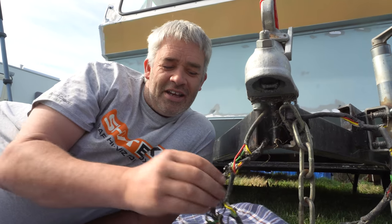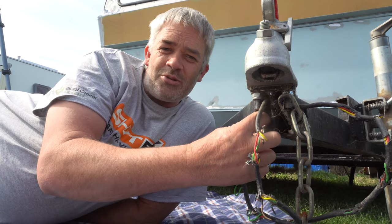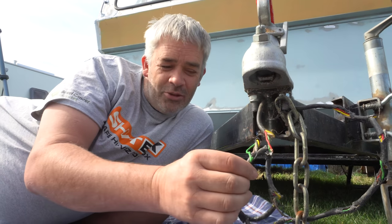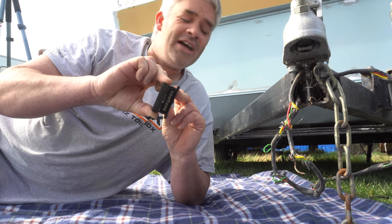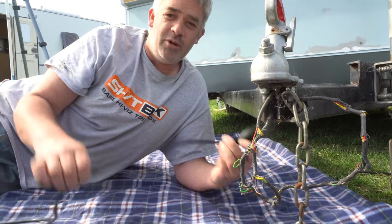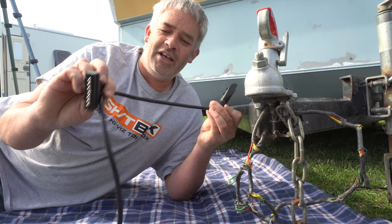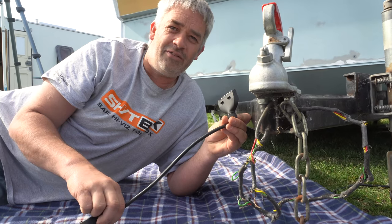After the dog chewed a little bit of the cable, I took a bit of an investigation. I can see it's quite taped up here and there are more connections already being cut and spliced in. So I thought it would be time for an overhaul. We're going to put a female end — which is normally on a car — on the caravan so it'll be tucked up out of the way and won't get damaged. Then we'll have an extension cord going from here to the car, so whenever you park up you can take the extension cord away and it won't be dangling or caught up at the front of the caravan.